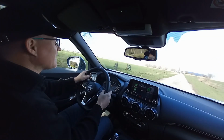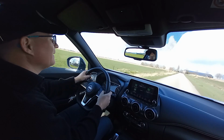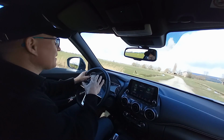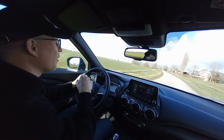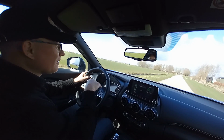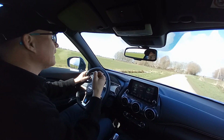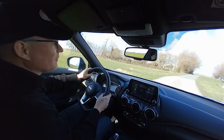But I noticed yesterday evening when I was driving and did a little bit of faster driving, exiting from corners and entering corners under hard braking, the gear shifts are seamless, and the way the petrol engine and the electric motors work together, and how the synchronization of those unsynchronized 4 gears is done, that's all seamless. And even under hard braking, when the car is downshifting, also the regenerative braking and the hydraulic brakes have to work together.